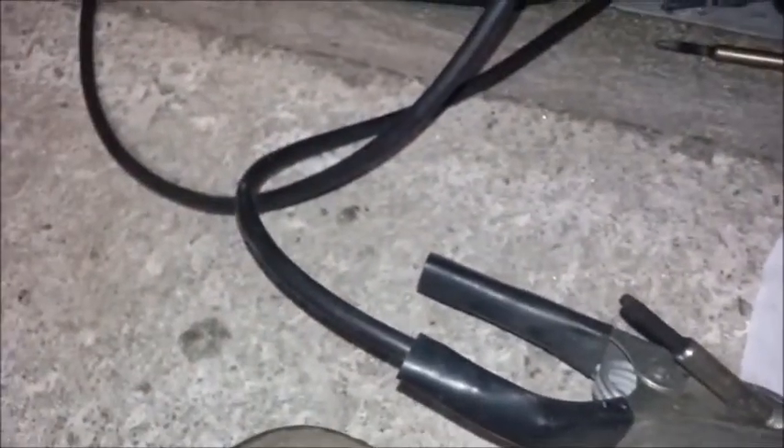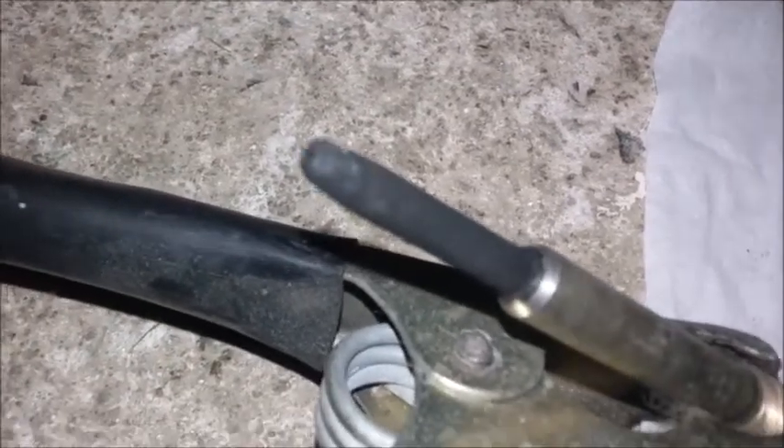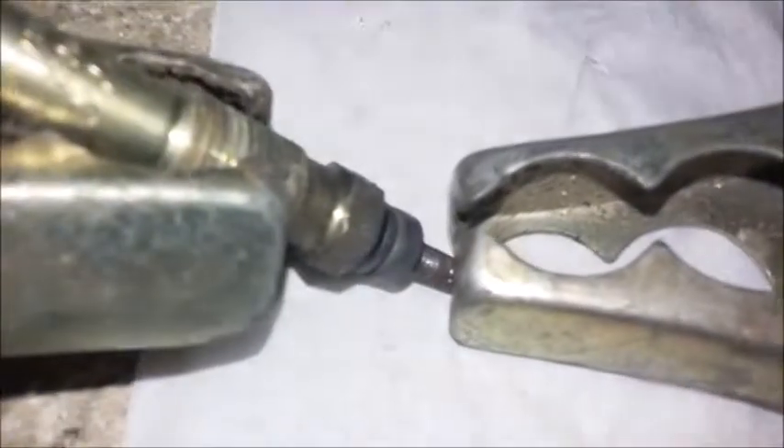You can tell when the plugs are possibly gone when you're taking them out by the look. If they're covered in carbon like that one — covered in soot — you can see that one just doesn't work. That's dead. So that's a quick indicator as you remove the plugs from the car as to what's going on.